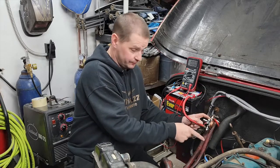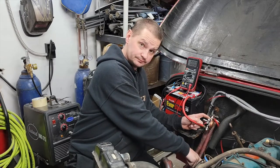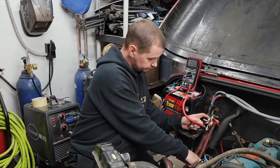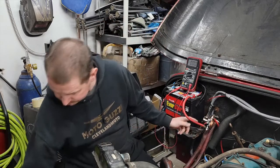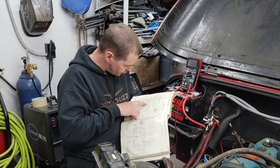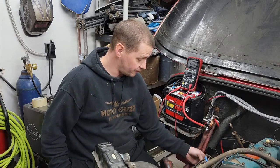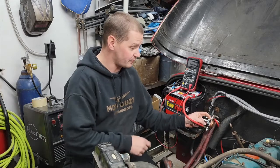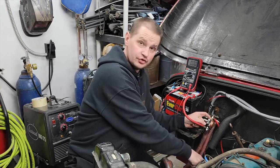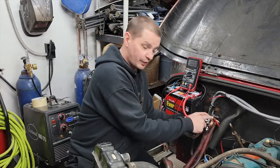So how I need to rewire this: this 12-volt lead going down to my coil — let me double check this really quick. Okay, the coil gets the splitter. So I need to run a second wire from my coil. One is going to come off of the I-terminal — this is the I-terminal. The I-terminal is going to have a straight wire running from here directly to my coil.